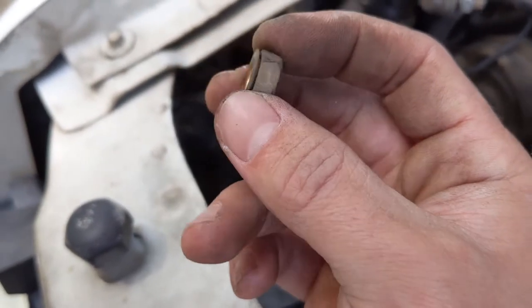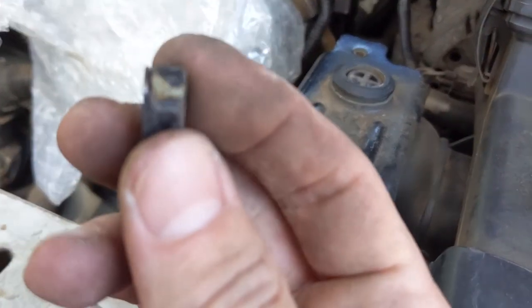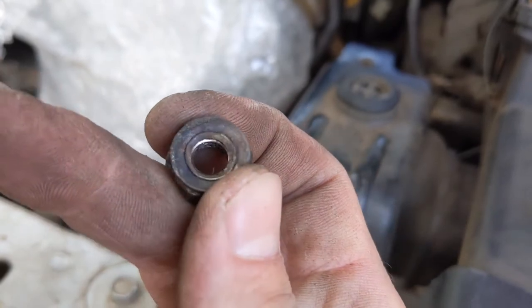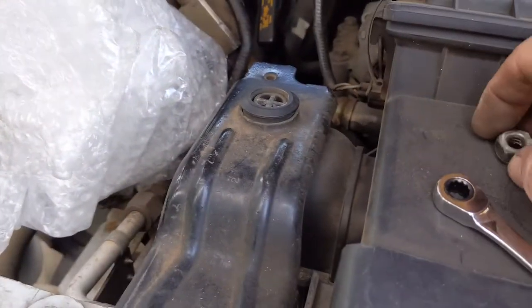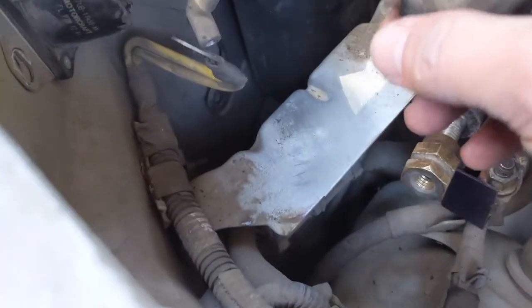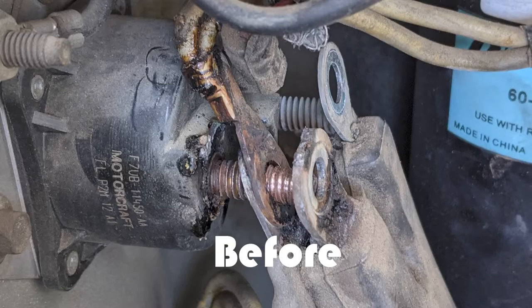On the starter solenoid, to take these off the main terminals it's a 14 millimeter, and it's pretty easy to reach back in there with a socket wrench. You can see how this one is pretty gummed up from melted insulation, which would lead me to believe that side was really loose and things got way too hot. So there's a very good chance that's what's causing the shorting on the starting. I removed all the wiring connected to the starter solenoid — a lot of it was damaged with a loose connection, showing bad bare spots where buildup had accumulated.